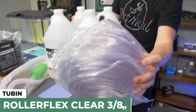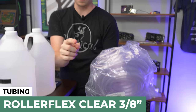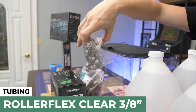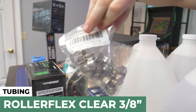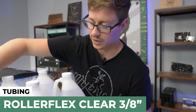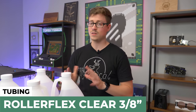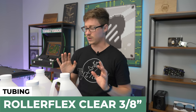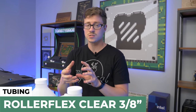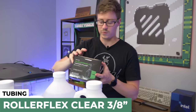For tubing, we have three-eighths diameter clear tubing — pretty malleable. You don't want stuff that's super stiff because you need to put it over fittings. To seal the tubing, stainless steel hose clamps — don't go with mild steel because you'll get corrosion and rust. A lot of people comment about rubber falling apart and things getting stiff and brittle. That does happen — we've seen parts get stiff, like cables and power cords after a year in oil. But we've never had anything break down or deteriorate.